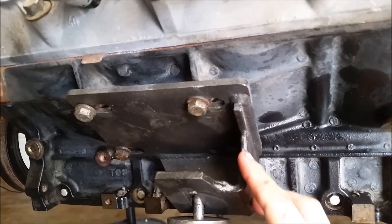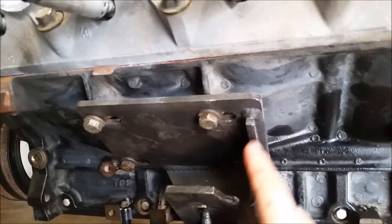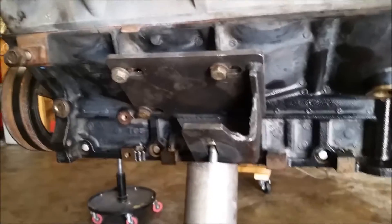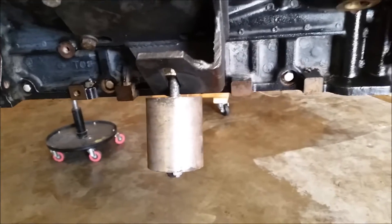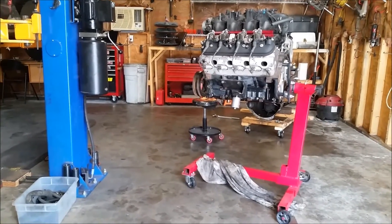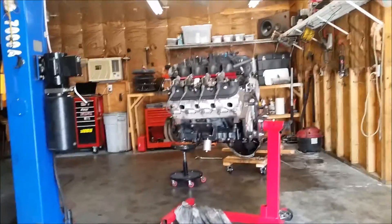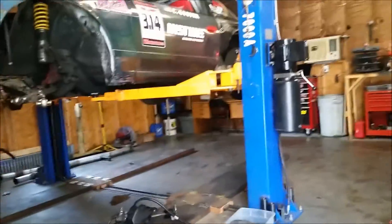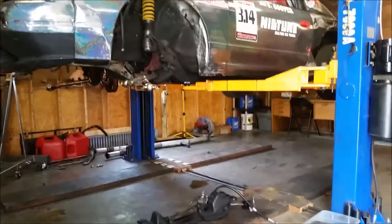The other side is the same — I cut for header clearance here and possibly a little bit here as well, with the same built-in tolerance. These are solid aluminum mounts I got off eBay for a 240SX — they pretty much just replace the OEM rubber mounts. I hope this video helps some people out. It's a lot easier to show things with the engine out of the car, and if you have access to a lift definitely take advantage of it. Thanks everyone.